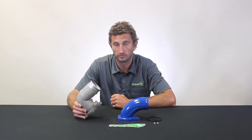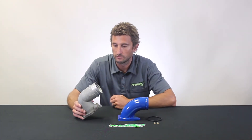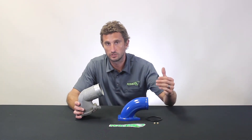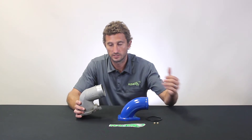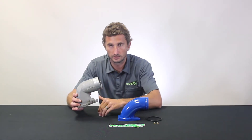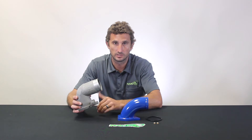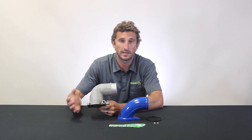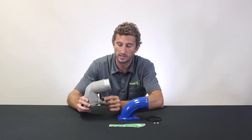Right on top, right where you can see it — this piece takes all the air coming out of the post-intercooler charge tube on the driver's side and delivers it down to the intake manifold just below it. The big issue is it looks pretty much exactly like a PVC 90, and it has absolutely no bend radius on the inside — just a sharp corner.